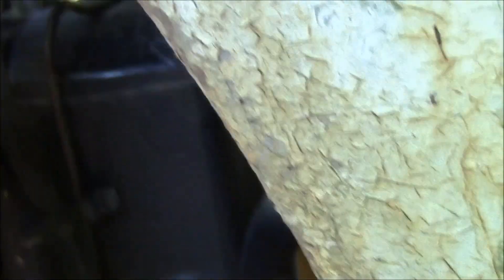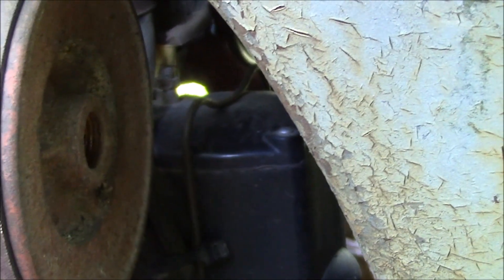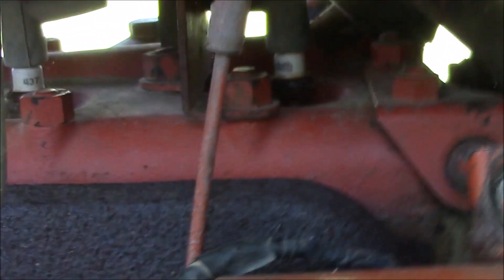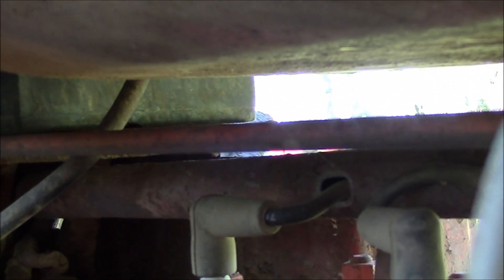Let's see if I can zoom in — there is a single wire coming to the top of the coil that's going to have to be replaced. It's that yellow wire coming down to the top of the coil right in here. Those wires come into this metal tube along with all of the plug wires and then they run under the length of this gas tank. We're going to have to get the old wires out and fish the new wires back through that tube.